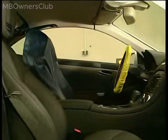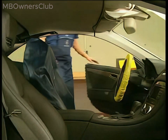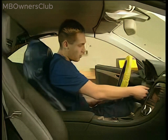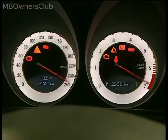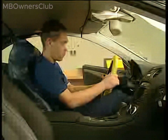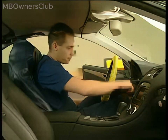Lower the vehicle again. Switch off the ignition, then start the engine. Fully depress the brake pedal 5 to 10 times. If no fault message appears on the display, the application routine was successful. If a fault message appears, repeat the activation of the application routine.